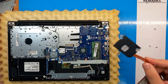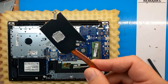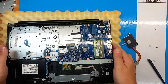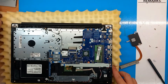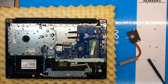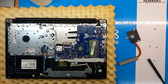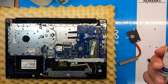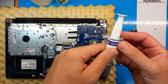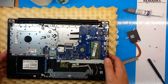Here we have it. As you can see, the paste is dry here as well as on the CPU. Changing the thermal paste once in a while is always a good idea. The things we need for this job are just plain toilet paper or some soft tissue, surgical spirit, and of course thermal paste — also called thermal grease.